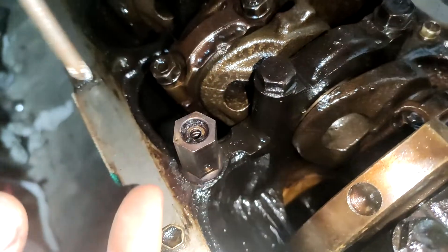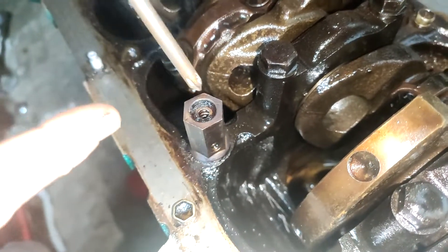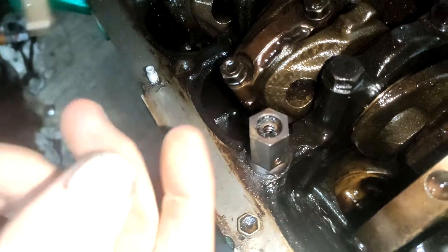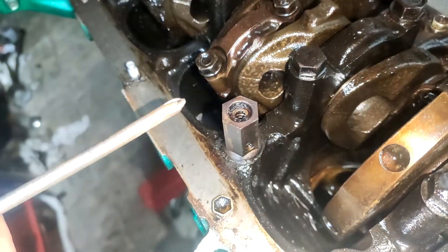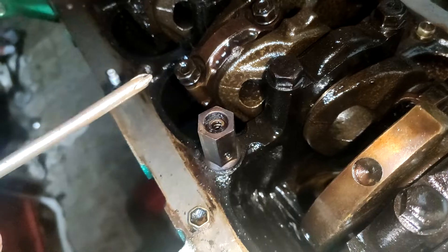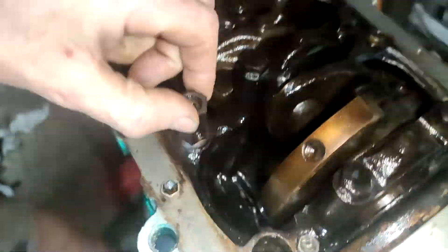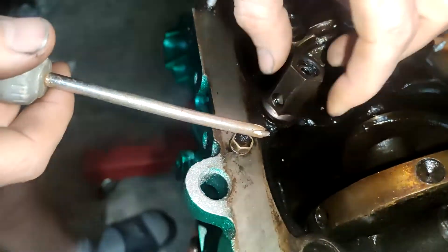What you can do is you can get another spring, or another way is you just whip this clip out, put some washers in here, and it'll make the spring a bit more tense. That will bring up your pressure. I normally put about 3mm, and that will give you around about 100 psi of oil pressure. With 2mm — which is two washers — it's around about 70 to 80 psi. So very beneficial if you want to do high RPM. This is how I've been able to do high RPM without blowing up my motors.